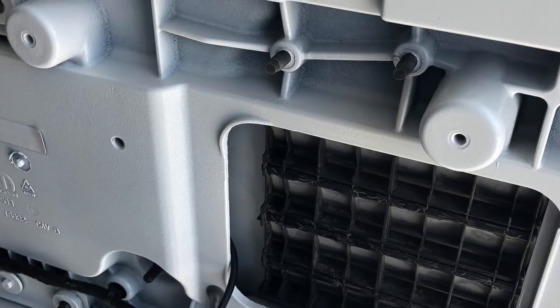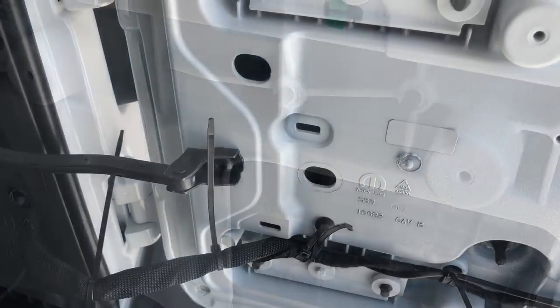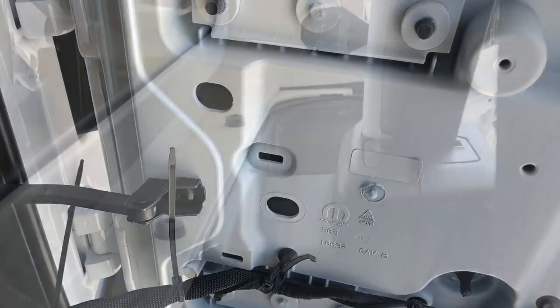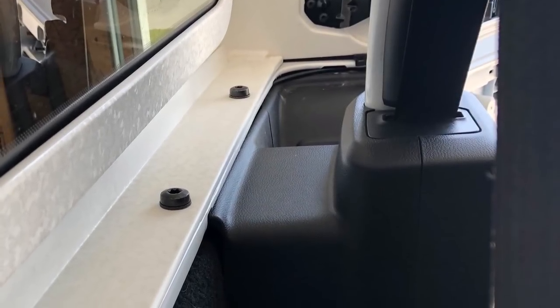I installed the CB radio cable by removing the rear inside plate on the tailgate and running it between the carpet and where the body meets the hardtop. Once I reached the back door, I went under the carpet the rest of the way.